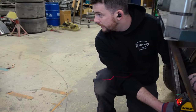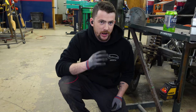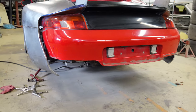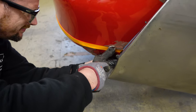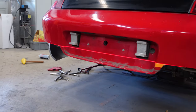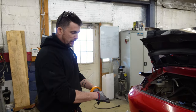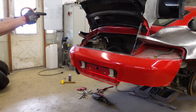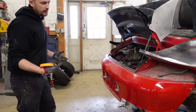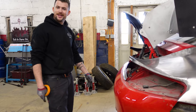I have the car fully leveled out, so I can use a laser level for my lines across the bar to make sure things are level. A laser level is another tool I use very often and I'd highly recommend having — they're not terribly expensive and they're kind of invaluable. I ran into an issue: my line wasn't fully symmetrical. The taillights were being pushed down by the duckbill and were putting pressure on the bumper, making it skew a little bit, so I pulled them out. It's okay — it's putting pressure because it's not fully finished, but I didn't anticipate that before I lasered it. So we're going to re-cut it.